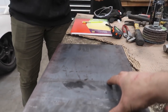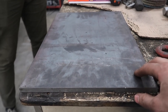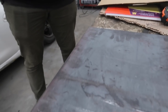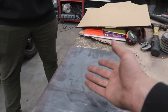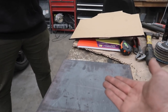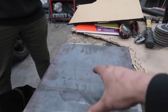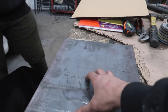I know that there are companies and people who have made skid plates, including myself, out of quarter inch plate, but to be honest, I don't think that's thick enough — especially when you have this long of a section. If you hit something right in the middle, it's going to have enough deflection in the metal where, if your motor is only raised by the quarter inch plates that people do or that certain companies produce, it only raises it like a half an inch, and that is absolutely going to just destroy your pan.